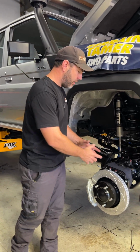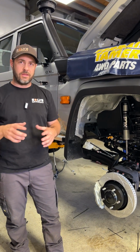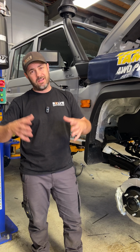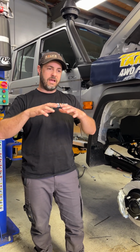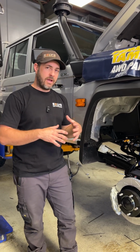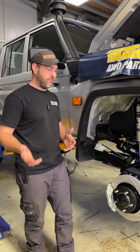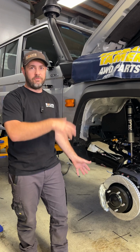Moving further into the box, bigger gears, different bearing construction and design, the way the idler bearings all work in this, massively different. They're bigger in diameter, the box is bigger again. The internal design of the box has allowed for more oil volume, less cavitation of the oil, things like that. So anywhere where you could make an improvement, even if it wasn't needed, Marks went and made it. They found out all the bits that weren't even an issue in the old ones and improved those yet again.